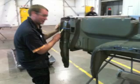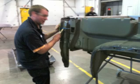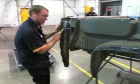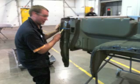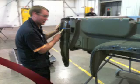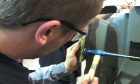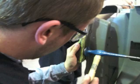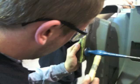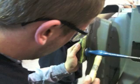Okay, so we got the bedside removed. Now there may be a little damage to the flanges and around the bedside where it was attached. So we're going to go around all those areas and make sure they're good and straight. We're going to hammer and dolly any damaged areas or any area that needs attention. Then we're going to go around where the welds were, grind that, clean it up, and get it ready for the new panel.